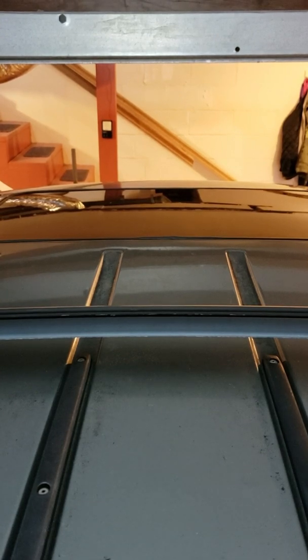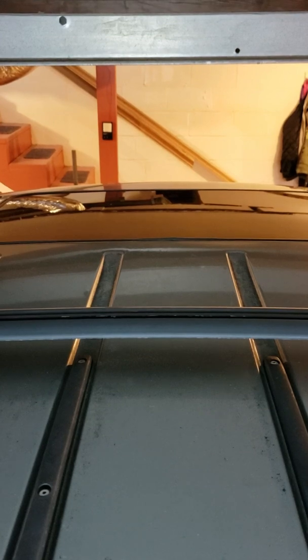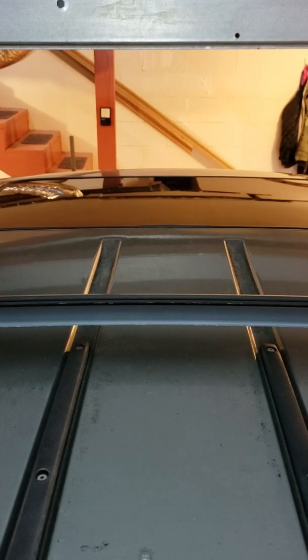What you haven't seen on camera is I've had this truck in the garage for a couple days, nice and warm because it is cold out. So any water that was in there has been evaporated. We've been keeping it nice and warm in here. And also I took a cleaning cloth, some spray cleaner and some paper towels, and cleaned around the edge where I'm going to be applying the epoxy